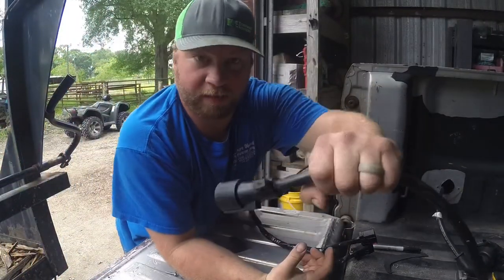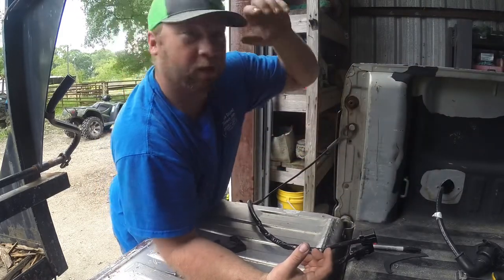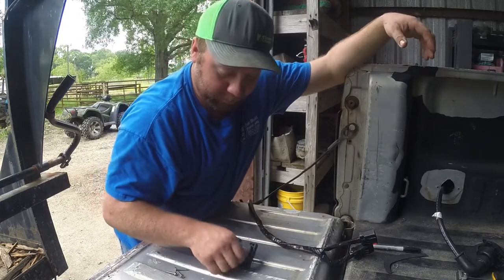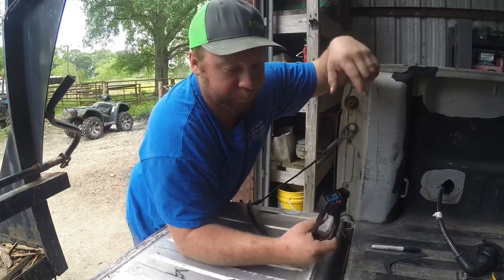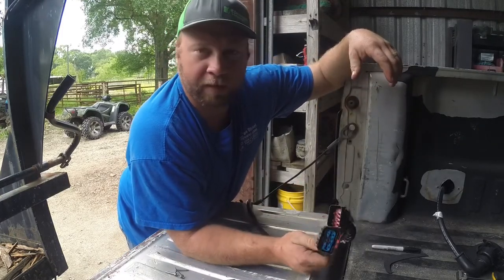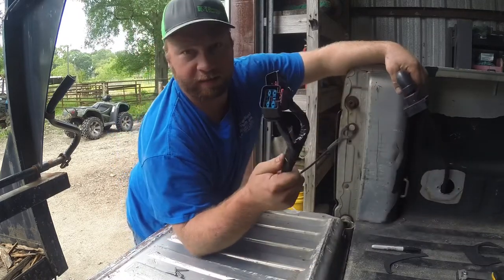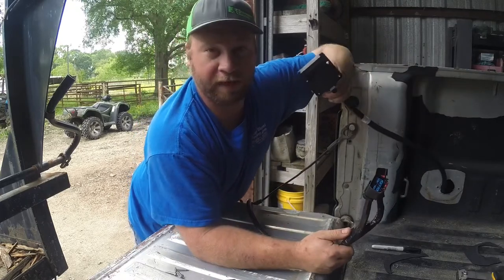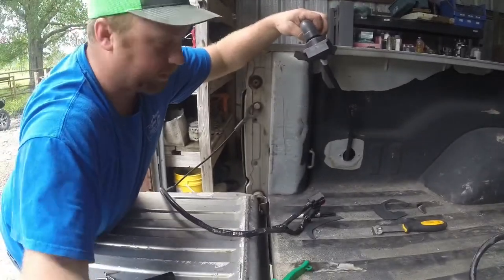And there's a connector that's built in, all sealed up. Well, it's not long enough to go with my tailgate to the factory hitch underneath. So I got online, and I'll put a link in the description below. I bought a kit. It's like $100 shipped to you off of etrailers.com. What it is, it connects directly into the bottom connector to put in a new 7-way. And this truck had a 5-way already in it.